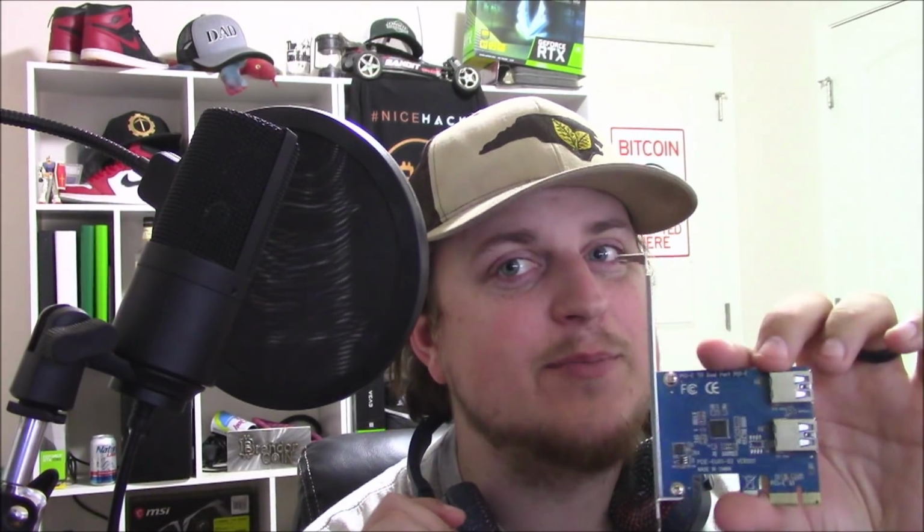The first thing you want to make sure, the 100% first thing, is that the system will post and go into whatever operating system you're doing before you install this. So what I mean is, does the system actually work? Because so many people will put together an entire rig or an entire build, install this, and they've never even run the system without the adapter, and then they don't know if they're running into issues on the motherboard, CPU, RAM side, or the adapter side.